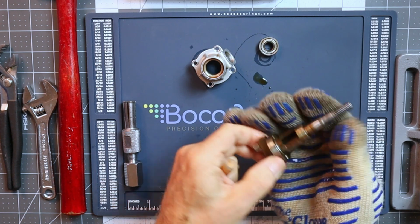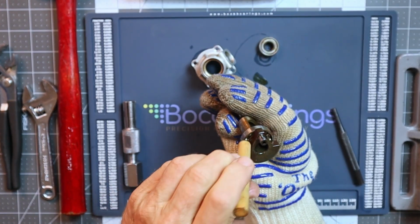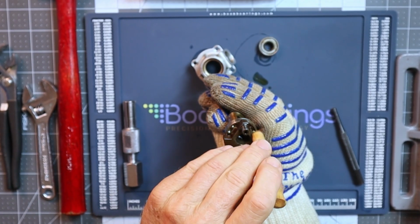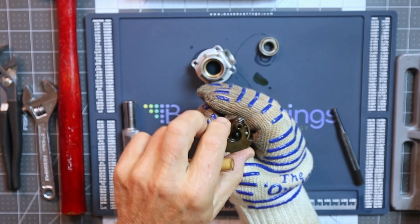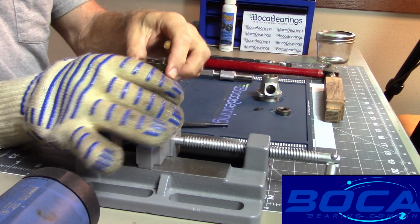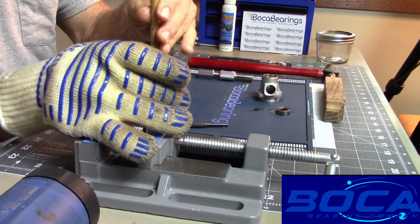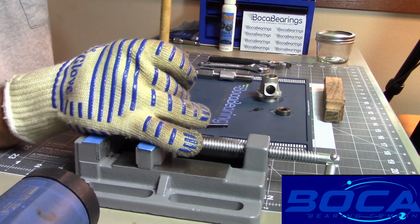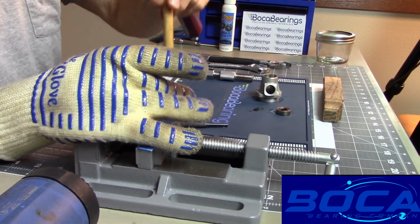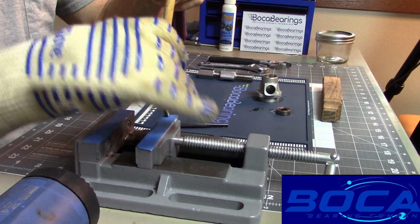The method to employ to remove this bearing now is I'm going to start with the dowel, see if that works. If not, I'll have to move to a punch, and just alternately tap on this thing while turning the crankshaft to get on all the sides of this thing. I'm just going to put it right here. Oof, that's really warm. Let me just see if the dowel's going to... Okay. The dowel's going to work here. This is coming up really easily.